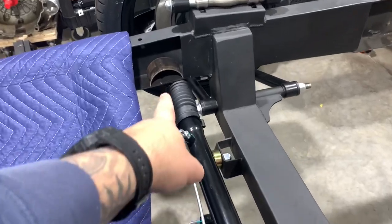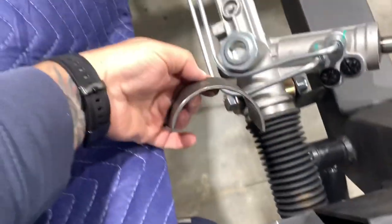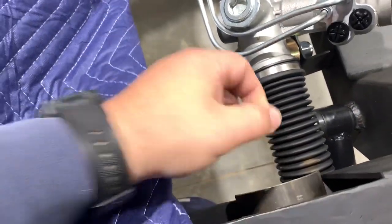Tire size for the back — obviously we're going to go with the same rims, but they'll be a 20-by-10. The fronts are 18-by-8s. I think the rear tires are going to fit without any chopping or tubbing, but if I do have to tub the bed, I'm okay with that. I don't think they're going to rub the fenders, but it'll be close — I think we'll go with like 295s, which is about an 11 to 11.5-inch tire when inflated. We'll do what we have to do to make them fit. We also received our C-notch kit from viewer Scott — we really appreciate you, buddy, thanks for hooking us up with those.